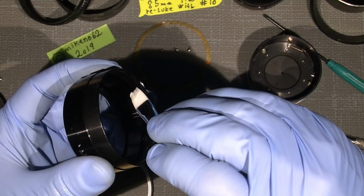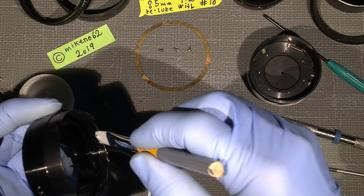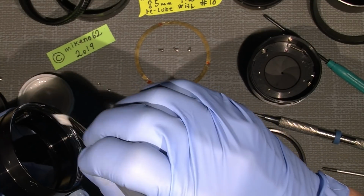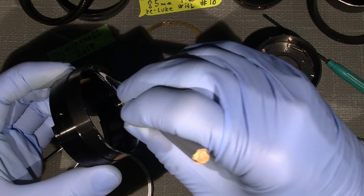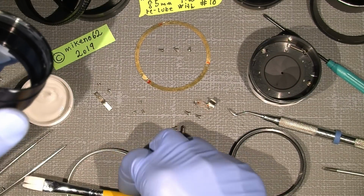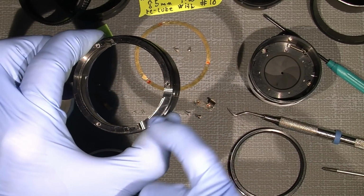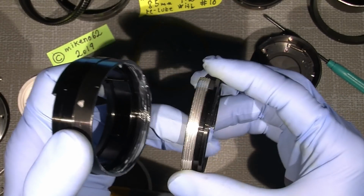Oh, something came out here. And when it's at here, I will just put in the focusing ring itself. And by the movement of the parts, I will spread the grease in here. So find my mark, which is here, close to the edge of this where the aperture ring is moved. And then I have my mark here on the focusing ring,